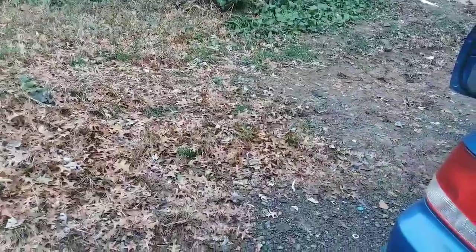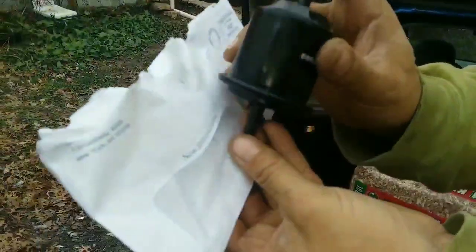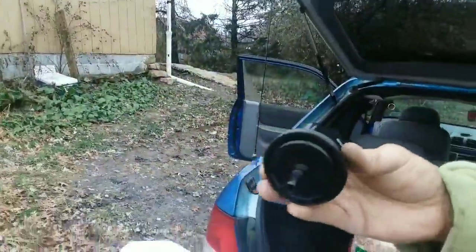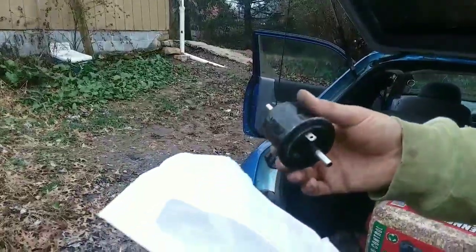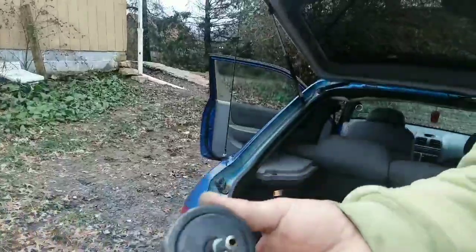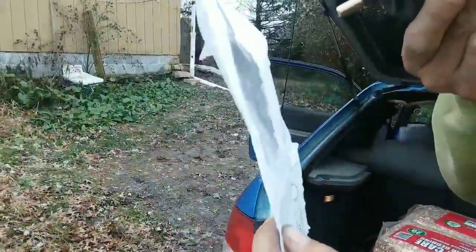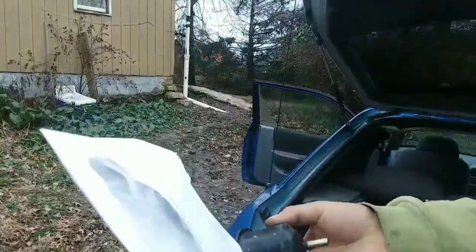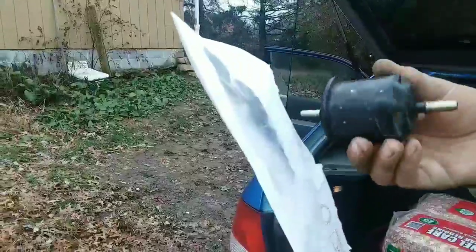See if I can get a piece of paper. This right here is our new filter, and this is the old one — this is your feed direction, so you want to blow this way out, and you can see the paper move. Brand new filter, it should flow right through. Now this is the OEM one — you can see the Honda symbol. Remember, you can blow this way through it, but blowing backwards it's not moving well at all. That might be why the car is running lean.